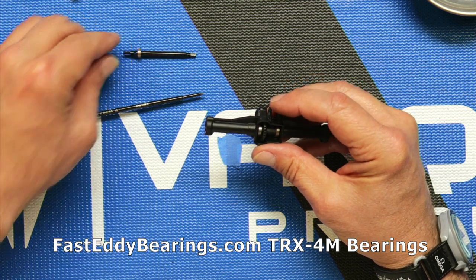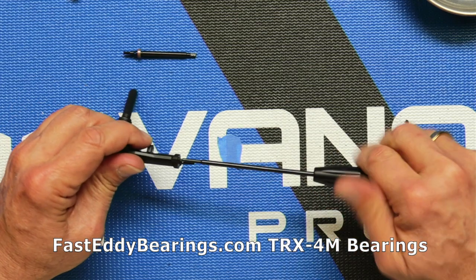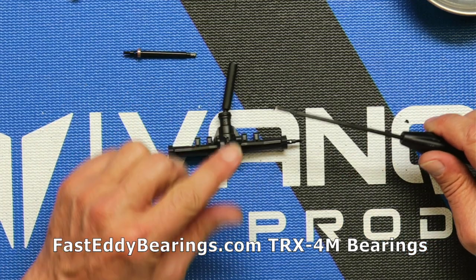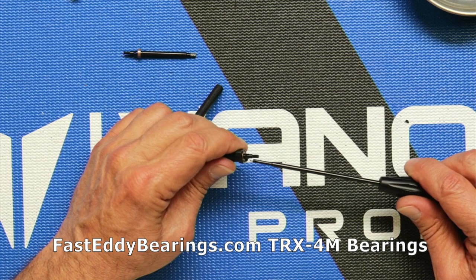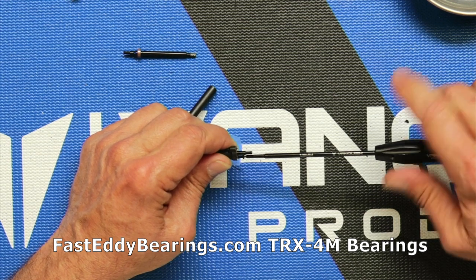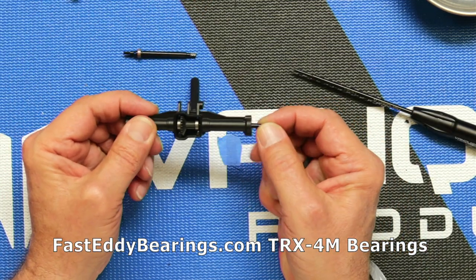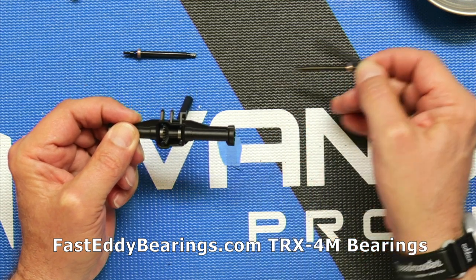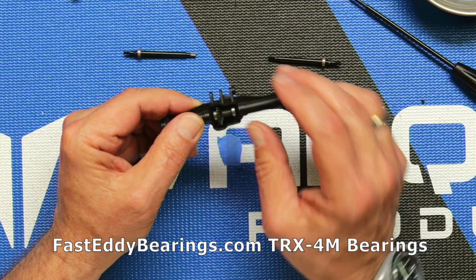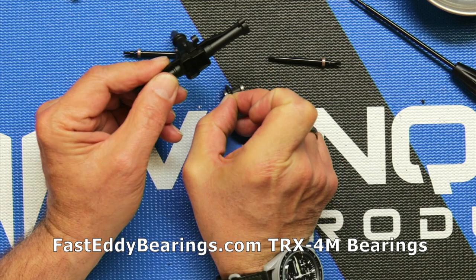These two little screws are out. Let's gently pull — and this axle shaft is coming out. I'm going to set that down right here and go ahead and do the other side. I'm trying to keep the axle in the same direction so that we don't get parts backwards when we put them back in. Being unfamiliar with this rig, I'm taking that extra precaution. Now it looks like we should be able to slide out the gears.